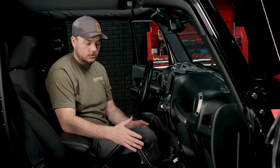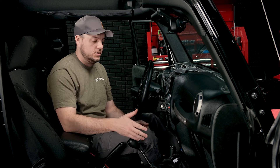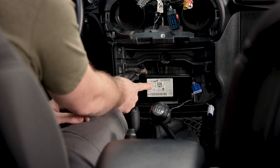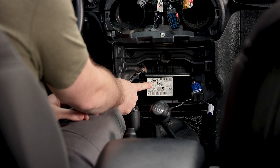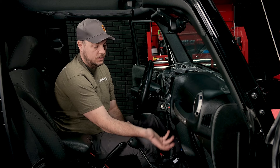You may have noticed our Jeep is a manual transmission, so we've gone ahead and moved the gear shift. If you have an automatic transmission and are having trouble, just move the shifter back — that'll give you a little more room to get that panel off. On our Jeep, this black box here is the Uconnect module, and there are two screws holding it in. We're going to remove those two screws and set the Uconnect module out of the way, because we're going to use one of the connections on there to maintain our factory USB.